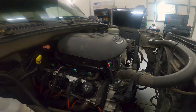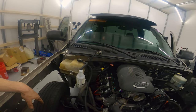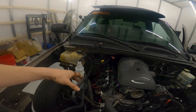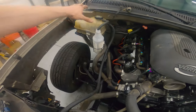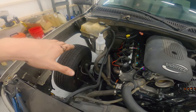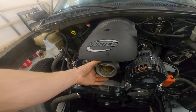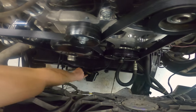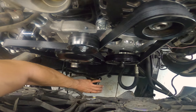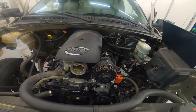She's all finished — as you can see, it's tucked up in there and you can't even tell it was done. The whole reason I wanted to do this is to clean up the engine bay. It allows me to get rid of the tube, the harness, and everything that goes over there. Stay tuned for the next video where I'm going to redo the cooling system to get rid of all these hoses. Since I don't have to run that mass airflow and that harness anymore, I'm going to get a tube that runs forward a bit and build a box so the air filter scoops air straight from behind the bumper — up the tube straight to the intake — so I get nice cool air and clean up more space in the engine bay.